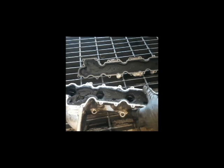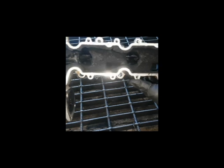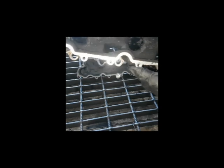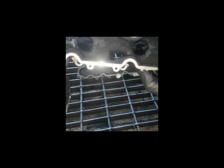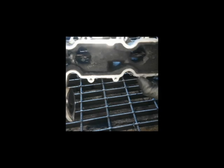So first we've got uneven flow, and then secondly, when we're at idle, the swirl valves are closed up to around that 2000 mark and then they'll open. So you'll find when we're approaching that 2000 mark where it starts to really buck and kick and just can't go, these are still closed and there's just not enough flow through those ports until the boost kicks in, then these will open enough and you start to get enough flow through there and the engine can rev through.